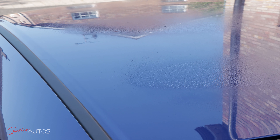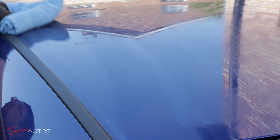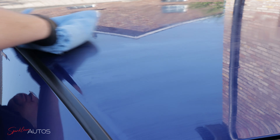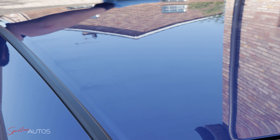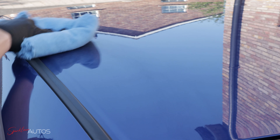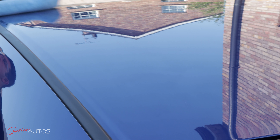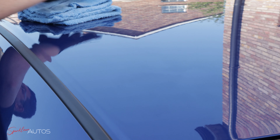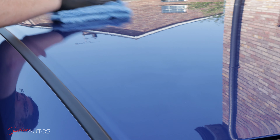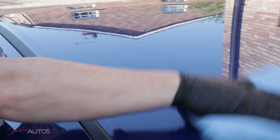Two to three sprays per panel as always, then gently spreading the product in a cross hatch pattern — there is no need for excessive downward pressure, I am simply trying to get an even coverage. Interestingly, the product was actually flashing off as I was spreading it. I'm not sure if this was down to temperature, but that was very unlikely as this was still only around 10am and the car was still in the shade. A quick swirly spinny folded cloth test confirms — no illusion — the slickness is definitely there.